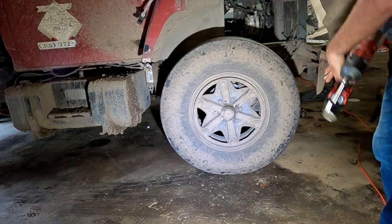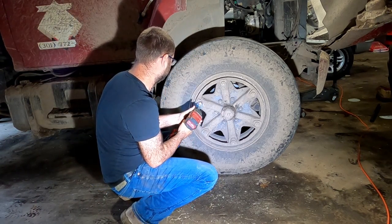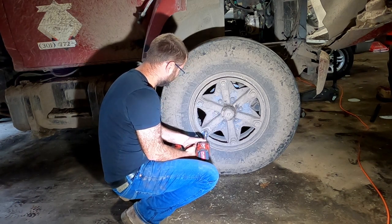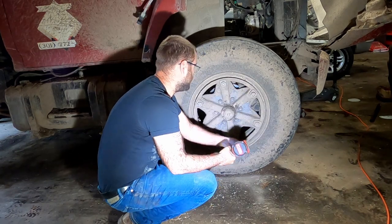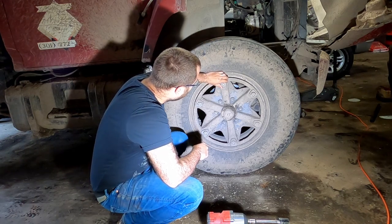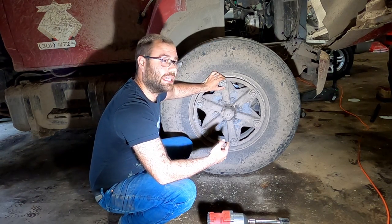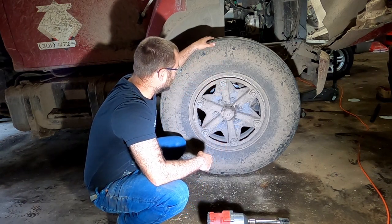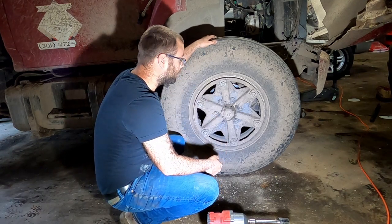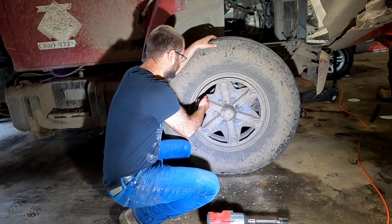These nuts are one-and-a-quarter inch — we're just going to loosen them, not take them off. With this wheel style it doesn't matter as much on the front, but you always want to leave the nuts on. In the rears these act more as a wedge, and they can bind so much that when you take the nuts off the wedges stay in place, you whack the tire, the wedges go flinging and you lose all your front teeth — or it doesn't feel good on your knees or shins either. So always leave the nut on until the wheels look completely loose so you can knock these wedges free.